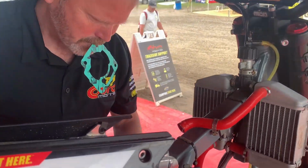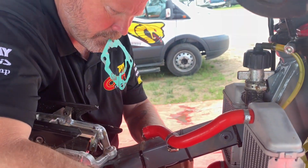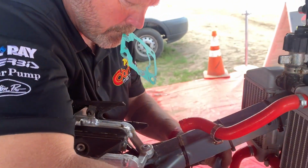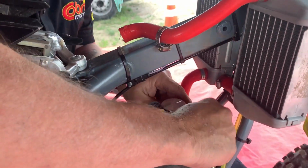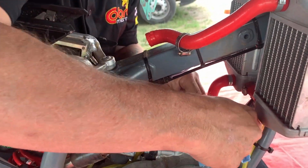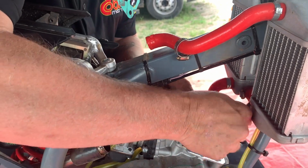It might have been around a 39, and there may be times you may use a 4 base gasket that's a 39, a 37, and you may get one that's a 42 or 43, and sometimes you need to do some tuning on these to do that. You know, this might be an example. We may need to tighten the squish up on this bike a little bit.